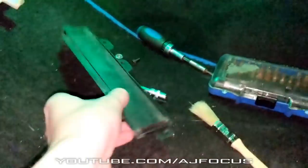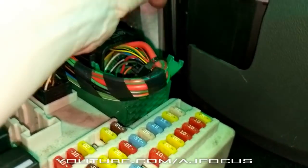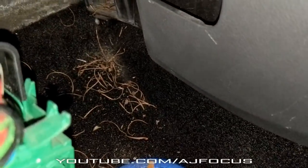Okay, so I've removed the casing — the cover. Weirdly, there's only two screws holding mine on, so whoever replaced it before obviously didn't want to go through the glove box to remove the top one. But if yours hasn't been removed, you will need to go through the glove box to get to that top nut. Anyway, they're tiny and they come out quite easily. So the filter sits in here. Just remember which way it comes out and which way it goes back in — there are arrows on the filter itself. Oh wow, look at the dirt come out of there! Look at all that — that came out of that filter box. That was just in there.